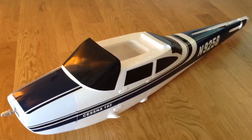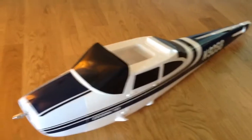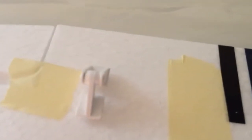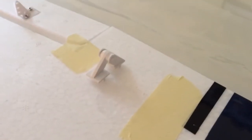I will do some mods on it, put flaps on it. I already started with the left wing. As you can see, I already cut the plates for my flaps servo. Here inside are all the plates for the cables and for the stiffness, the carbon fiber rod. Here I already cut out the flap and brought the hinges in place.